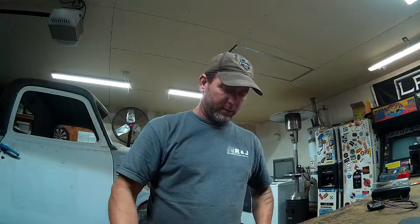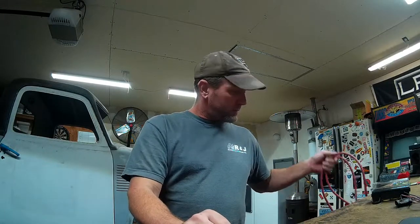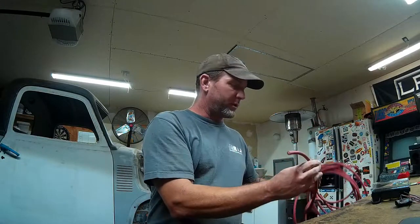That's where I'm at with the wiring. Still a lot to go, but getting this chassis harness done was a big step — everything's cleaned up and ready to install, and that's a big leap forward. I'll build those battery cables tomorrow after I get this engine harness mounted back through the firewall and plugged into the ECM. Then I need to get my power lines run from the battery — a 4 gauge wire from the battery to an underdash distribution block to power anything that needs power under the dash, and 2 gauge from the battery to the starter, then 4 gauge from that up to the alternator.